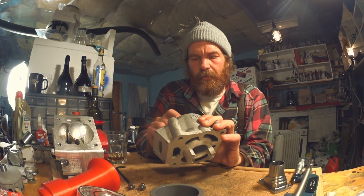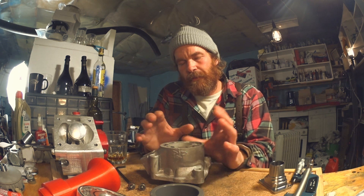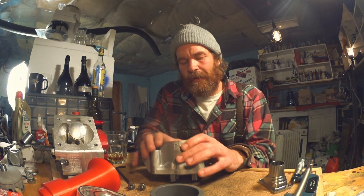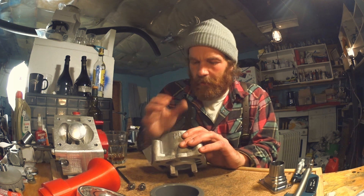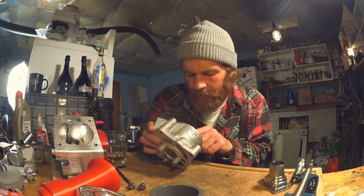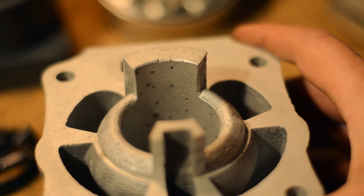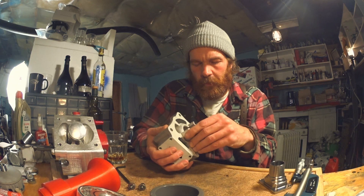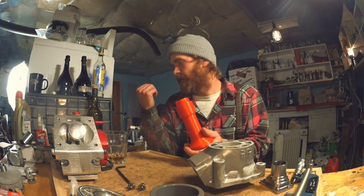Welcome back to my garage. In the last video we started stripping the plating off the cylinder. One comment described a much faster way of doing it, but I'm kind of scared of the chemicals involved — I like to keep it slow. There are a few spots here which I sandblasted, but no spots that didn't detach. We will have to hone the bore a little bit anyway to get a slightly larger bore and thicker plating, so those spots will disappear — no problem there.